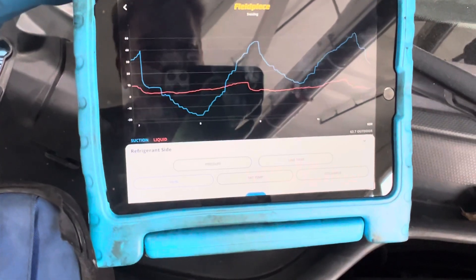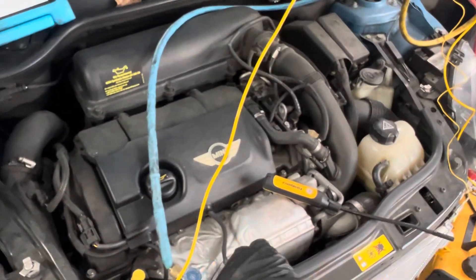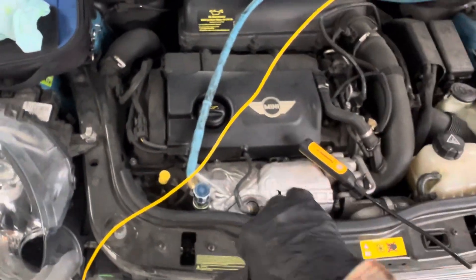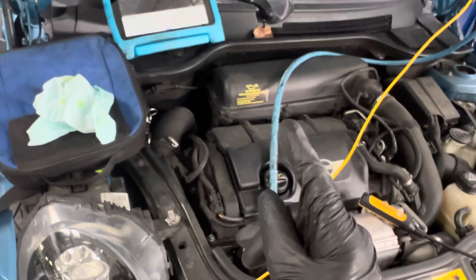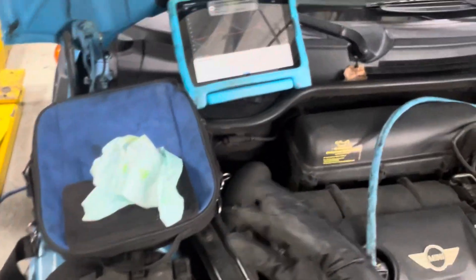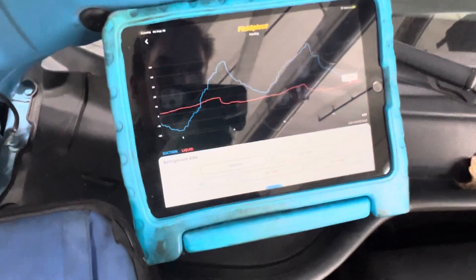And our superheat and subcooling — you cannot take a superheat or subcooling with a condenser fan that is constantly rising and constantly falling all the time. You never get a steady point, so you cannot use superheat and subcooling on a vehicle that is in operation mode of constantly up and down. It has to be steady state. This is why, especially when these heat pumps come around, every vehicle from the manufacturer through their software must have a test mode and they must release more information to us for doing proper diagnostics. But they think that mechanics are idiots who don't need to know all that information. The information is out there — they just have to publish it.